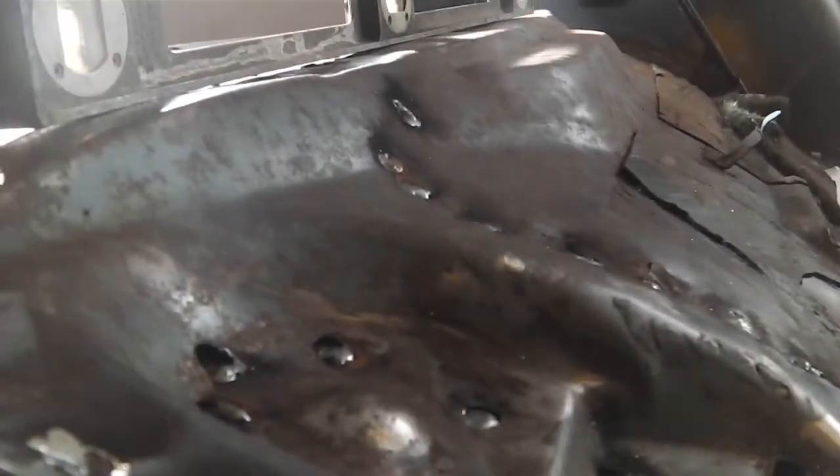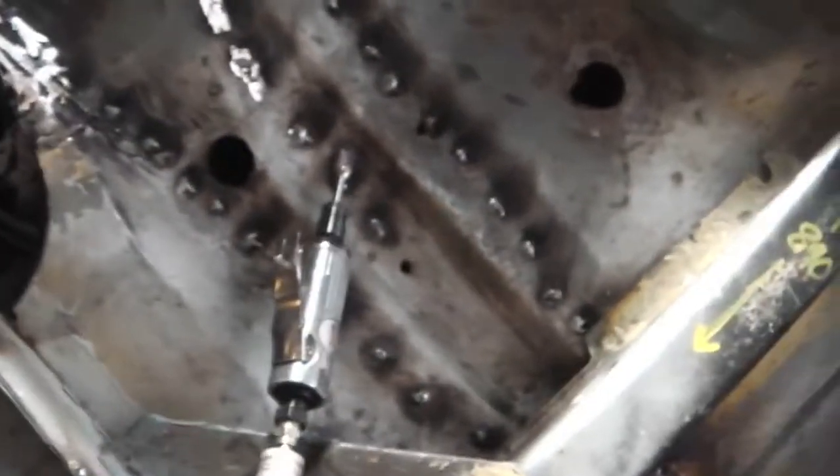So that's on. What I've done now is blocked up the back of the over-axle chassis floor pan bit there. I've chopped that up, got it level with the spirit level. Now that the chassis is on, I've put a block under the new chassis, put it on bricks and levelled it — the floor pan is solid as rock. And then the spirit level shows the bubble in the middle, so that's level. We're going to be putting on that back parcel shelf again and offering up the welds. Once I've finished dressing these welds I've got the die grinder running — we skim those up, tidy that up, and it'll just blend in once the die grinder's done its job.